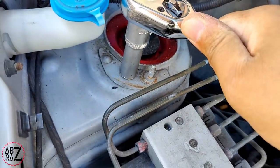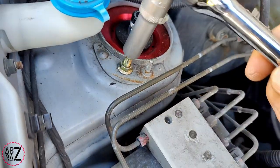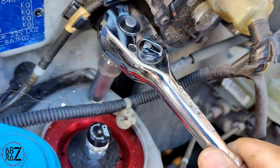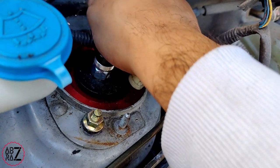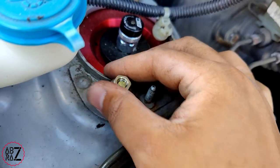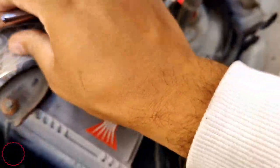The first thing you're going to have to do is remove the two nuts that are holding your suspension in the front of your vehicle. You're going to undo both those nuts and remove them. You can use a socket wrench or even a spanner, especially if you have an angled neck spanner or a deep spanner — that will help to get to the nuts as well. Then remove the two nuts on this side and then remove the two nuts on the other side as well.